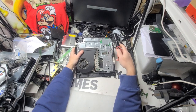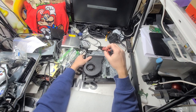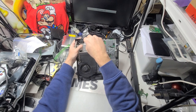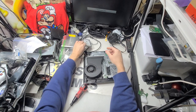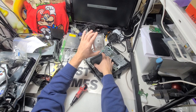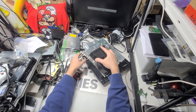The Xbox One and Xbox 360 is a completely different animal — it takes a whole process. You can't just throw any drive in it. With the PS3 you can put in one terabyte or even two terabyte; you just throw it in and do the safe mode update and it does its thing. Whereas with the Xbox, especially the Xbox One, you have to do an offline update requiring all kinds of steps. Anytime you see a mechanical hard drive, throw it away — you should never own a mechanical hard drive. Always go solid state; I'd rather have a 256GB SSD than a 500GB mechanical drive. They're fairly cheap too.